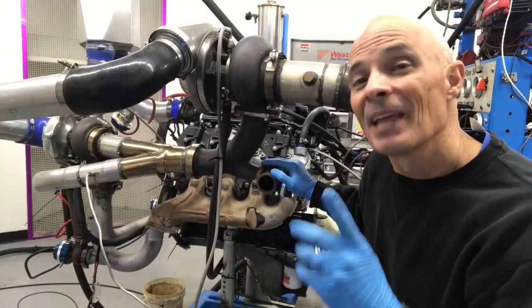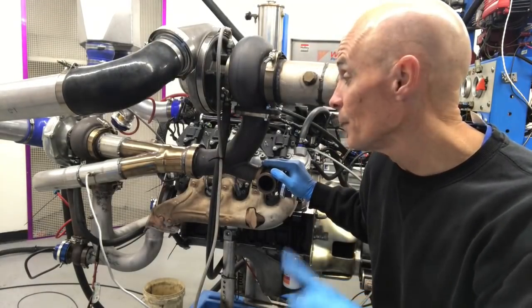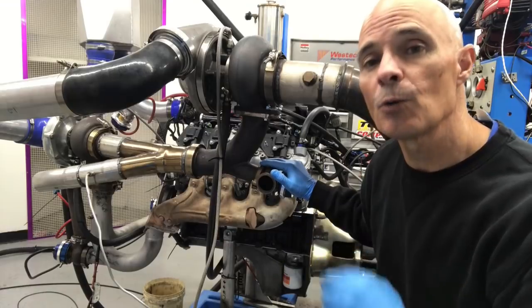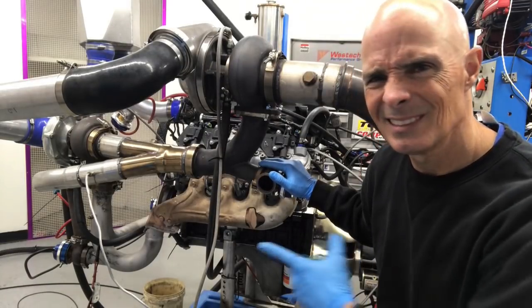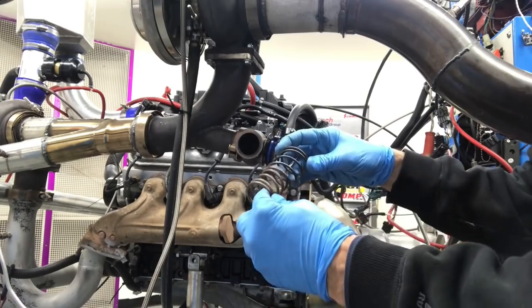To fix that situation and go up in boost, we decided to put more spring pressure in that wastegate between the big turbo and the small turbo. We're making some runs on the compound turbo 4.8 here and it's working pretty well, but the one problem is controlling boost — not that there's too much, there's not enough. The way we're controlling it: two wastegates in front for the small turbo with a manual controller set for 7 or 8 pounds. On the rear wastegate we have an electronic wastegate controller and no matter how much we turn it up, we can only get about 15 or 16 pounds. The reason is high back pressure — not surprising given that small turbo. So we're going to pull the 7-pound spring. Our big spring wasn't going to work, but we do have this — we're going to double it.